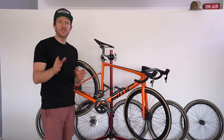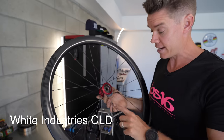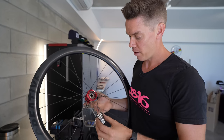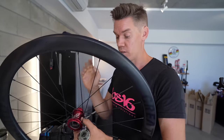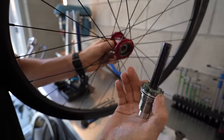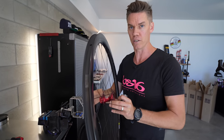The next one is White Industries — and this is the one Aaron was referring to at the start of this video; it's got like a metal sound to it. The White Industries has a 48-tooth engagement and runs a three-pawl system. They do have double teeth on each of the pawls, so you end up with double locking per pawl. Hub bearings on these are all Enduro — their high-grade Enduro steel. To remove the axle and free hub body, tooling is required: a tiny 2mm Allen key comes in through the porthole, you extract the left-hand micro-adjuster, and then slide the whole thing out. It's a little more fiddly than the DT Swiss, which just pulls off. They're beautiful hubs — probably the closest type of competitor to Chris King, handmade in the States.